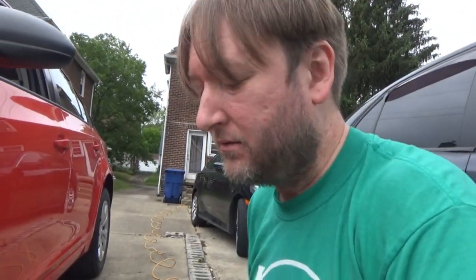So my dad took it to an independent shop. They diagnosed it as the valve cover gasket. And in the video, we did see that it looked like there was a little bit of seepage coming from the valve cover gasket. Not enough at this point in time to really be concerned about it. Even if it were the valve cover gasket leaking that badly, we would have definitely seen it start to run or pour out from where the gasket meets the head. And so, I don't know. They told my dad that, yes, it's a valve cover gasket. That's going to fix it.